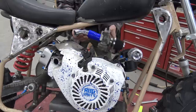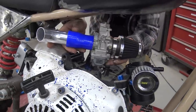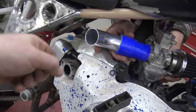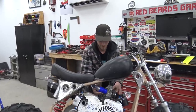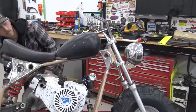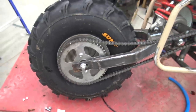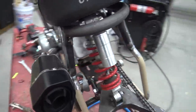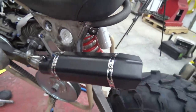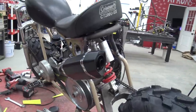The carb will sit right in the center of the engine. Go Power Sports has these carbs — everything will be linked down below. We'll have a 180 degree bend that goes up — I'll TIG weld it to a flange, and the carb will sit right there completely out of the way. This bike is sick, it's awesome. We're going to de-chrome it — I don't like chrome handlebars, they'll get powder coated black. We're going to build the little chain tensioners, the little ears back here just like normal where it pulls the wheel back. We'll have an actual chain tensioner pulling up on the chain and some nylon guides so if the chain ever touches the swing arm it won't hurt anything. And the exhaust — it's done. I already got a hanger mount right there just tacked in place. Completely away from where you're sitting — the shorty 40 looks sick.